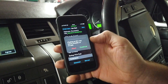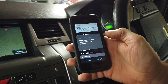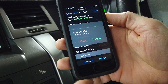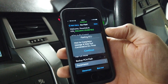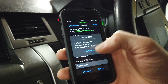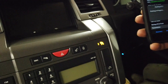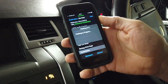We've now got the battery charger on - good job we checked. Continue, and it should show battery voltage on screen somewhere. Read the manual on what to do in case of failure. Flash duration: six minutes. We're going to write to the transmission - yes - wait for completion message and keep it all connected at all times. Make sure your phone has charge too. It's checking the voltage, and now all the lights have come on - like demons taking over your car. Flashing in progress.